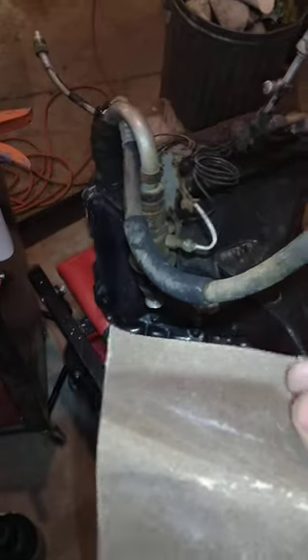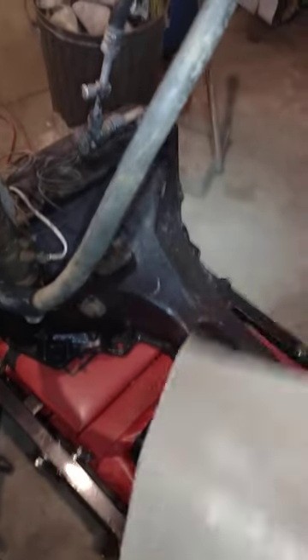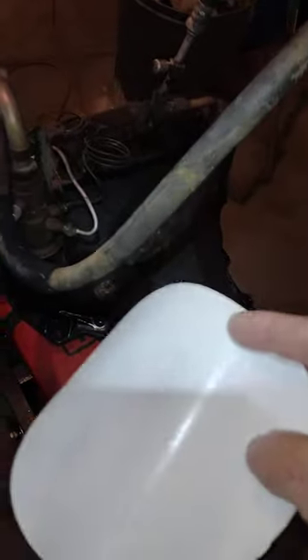Since it's fiberglass, I took 100 grit sandpaper — it doesn't have to be exactly 100 grit but you don't want something too coarse, it's pretty fine. I sanded the whole thing down and I plan on doing it probably one more time, going through and sanding it all down again with 100 grit sandpaper. Wiped it down and it looked better, but it still wasn't quite right.